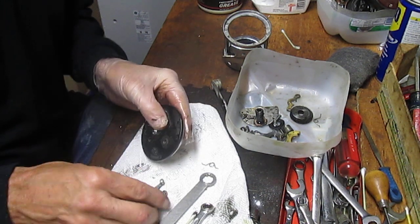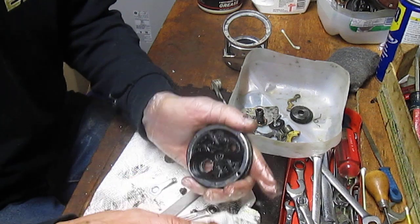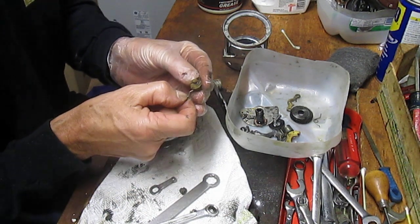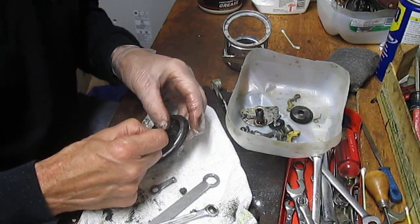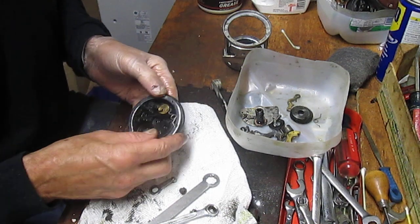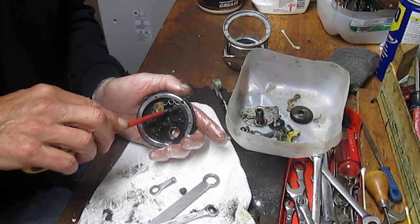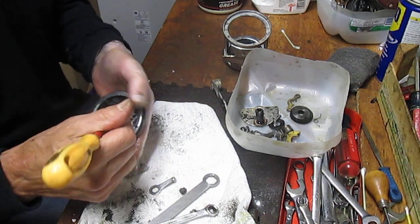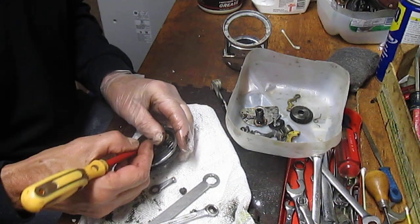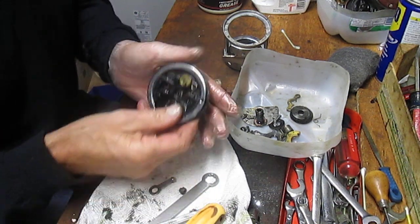Once we do that, we're going to remove the lever and the nut and push the eccentric through. This would be the eccentric. I'm just going to dry up any loose grease that's laying there, and then it's pretty simple to install. You want to take the little hook on the end of the spring and put it inside the hole in the eccentric. We're going to go ahead and reinstall that eccentric. The little hook fell out — no big deal. Now we've got the spring loaded.